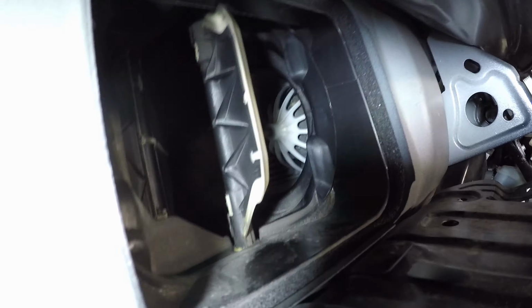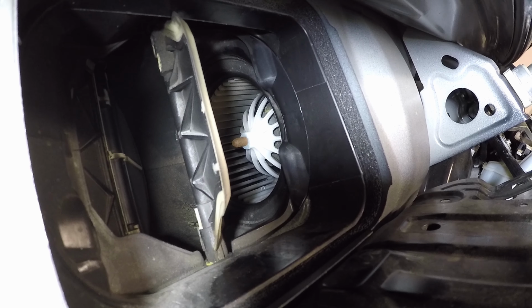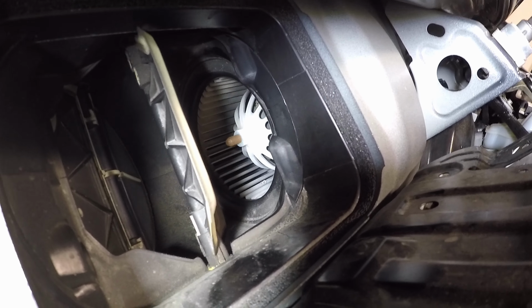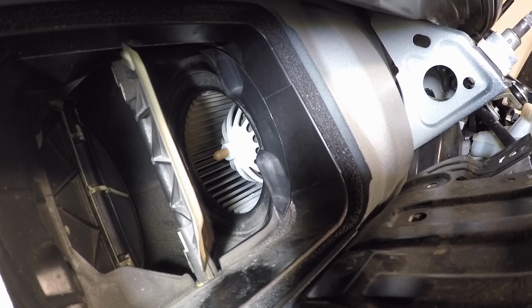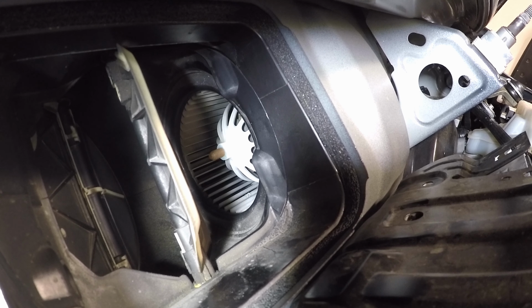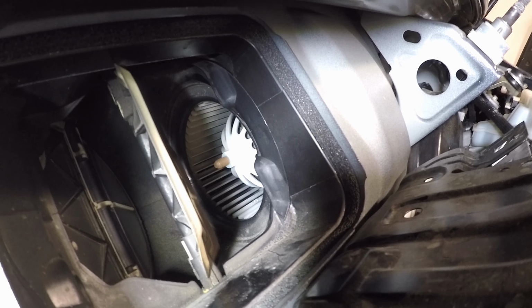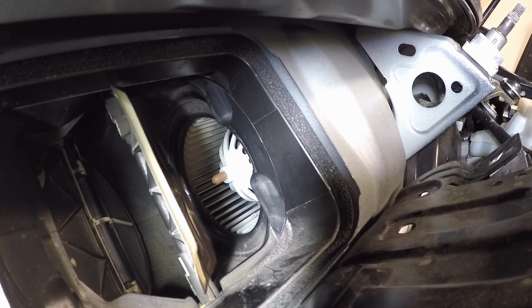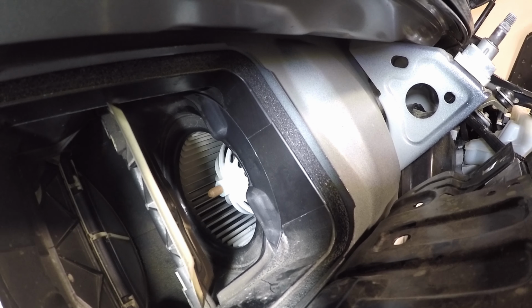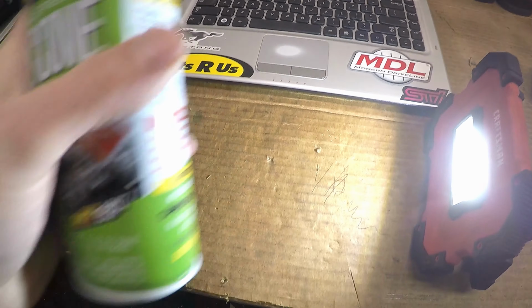Now what I'm gonna do, I don't think I'm gonna have a good way of filming this to show you, but where that rusty shaft there, on the other side of the fan is where the bearing is. So that's where you're gonna wanna spray your lubricant. So I'm gonna do that, and I will try and film it from my head cam, but it might not show up very well. So sorry if that doesn't turn out very well, but prior to doing that,